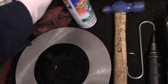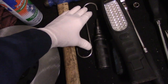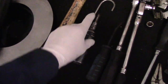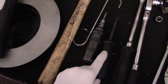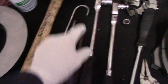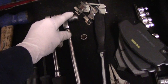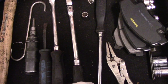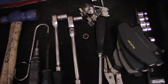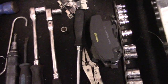First thing, this is our new rotor — we're going to clean it off with brake cleaner to get all the oil off. Tools you'll need: a hammer, a hook to hold the caliper out of the way, an impact driver to remove the screws that hold the rotor to the hub, a pry bar or large screwdriver, a ratchet with a fairly long handle for additional leverage. You'll need a 17mm socket, a 12mm socket, and a 14mm socket. Also a screwdriver, a pair of pliers or a line pinch tool to clamp off the brake line, new brake pads, and synthetic brake grease.